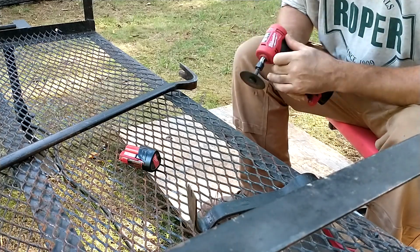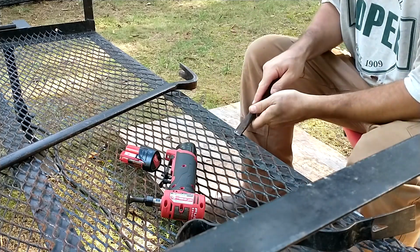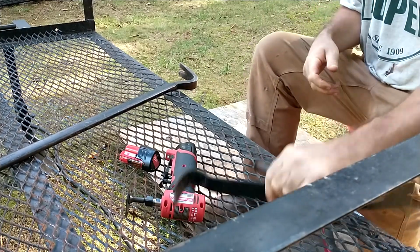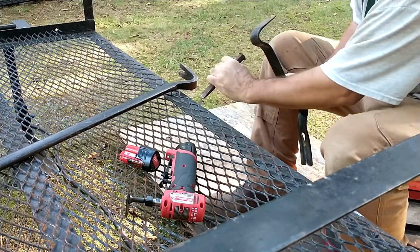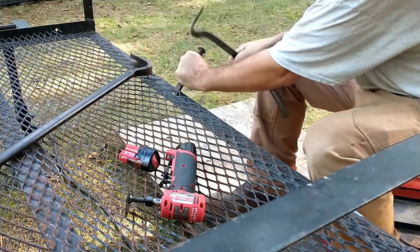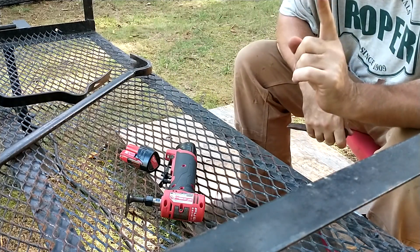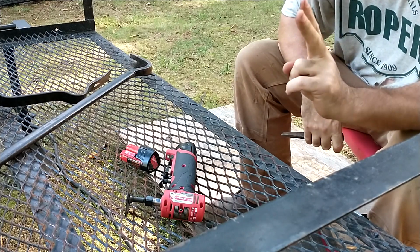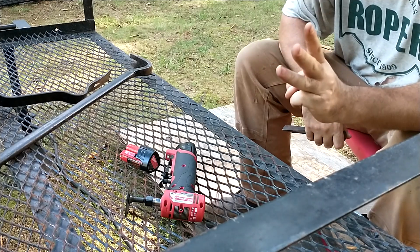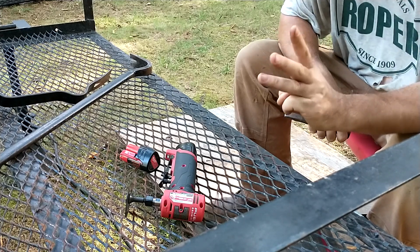I got it. Oh, my hammer went all the way sliding across the thing. And I knew that. There's just weld spatter everywhere that never got cleaned up originally. The trailer is out of square. The axle was out of square to the tongue. The tongue was way too short, like 28 inches or something like that, and it kept hitting the side of the truck, and you couldn't barely steer the damn thing.